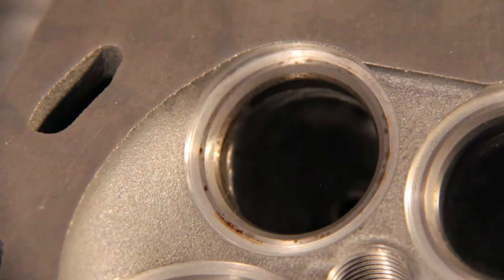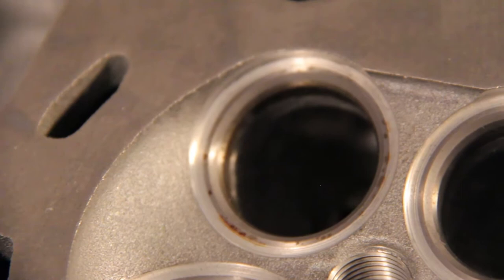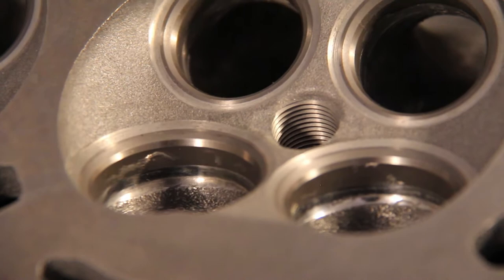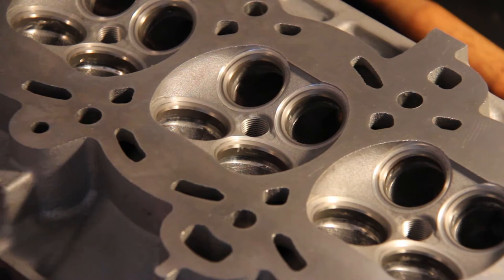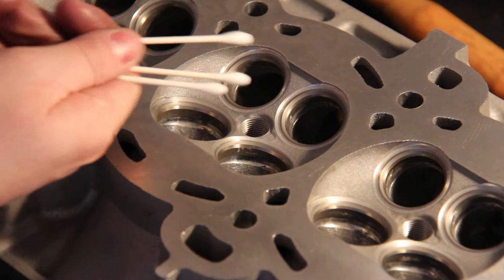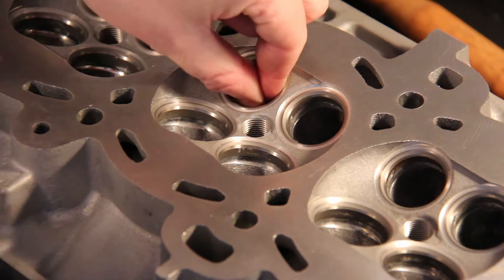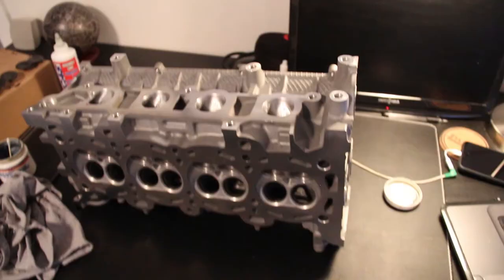You can sort of see now, even the roughest of the valve seats with the corrosion has a nice seat for the valve now cleaned up. As we go across all of the valves, they're looking really quite tidy - very clean and should make good seals. What I've done is I'm going through now with some q-tips and cleaning through each of the valve guides. There's obviously some oil in there from the valves. I don't want any lapping compound to get in there whatsoever, which I've been very careful about, but I just want to clean out as much of the debris as possible.